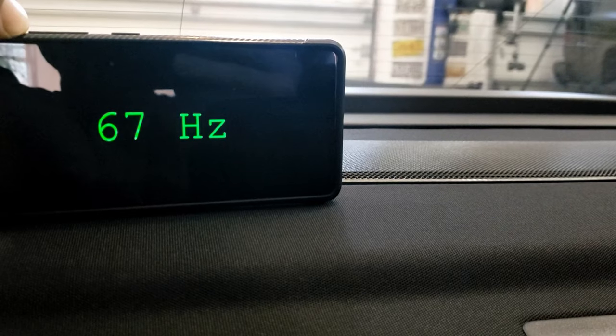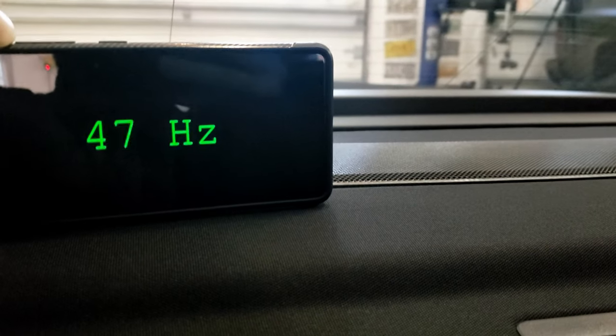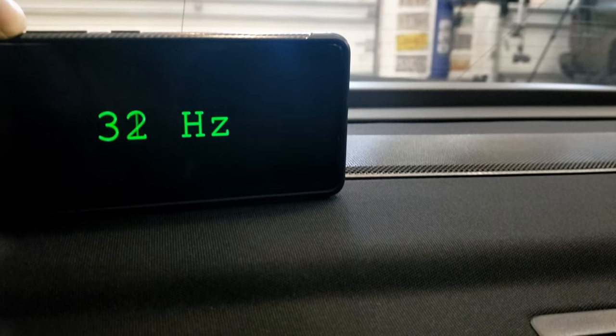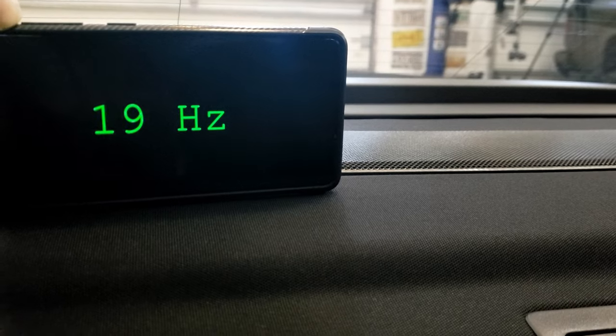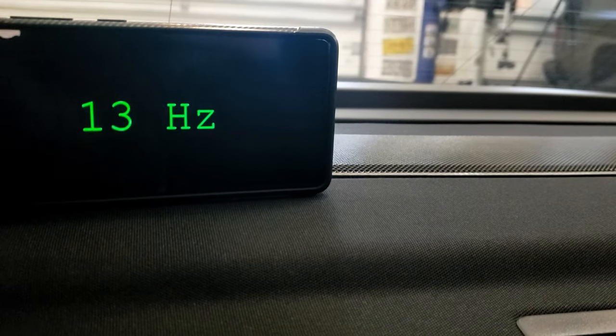Playing music for the video doesn't really help, but I did do a bass test to see if it hit lower. It hits much harder from 40 down to 20 hertz, while the factory sub started to drop off around 40 hertz and was completely gone around 35. So it does hit a lot lower — it'll definitely shake things in your car. Still hitting pretty good... probably right about 21 hertz where it drops off. Definitely hits lower and definitely shook the car a lot on its way down — a lot better in this test.